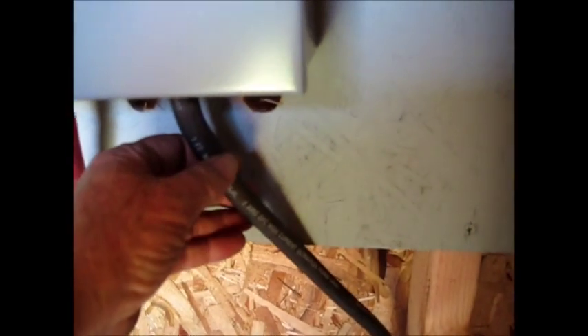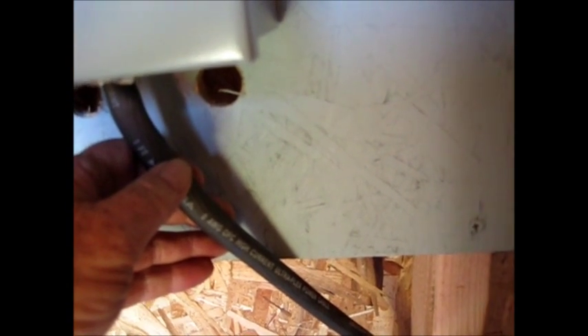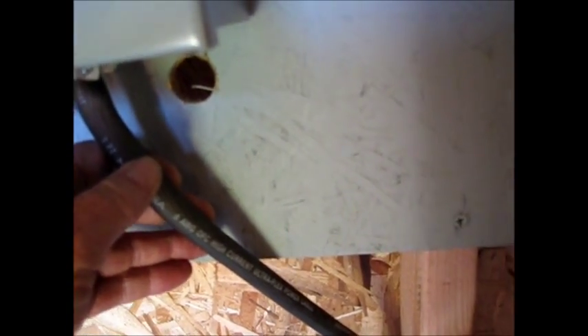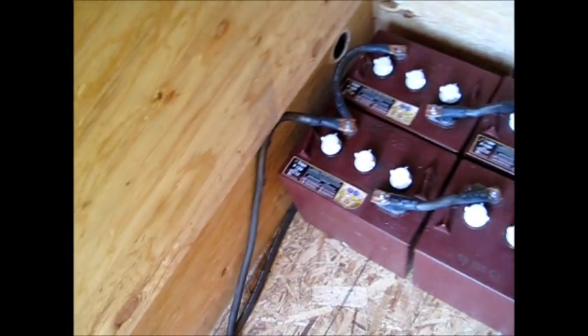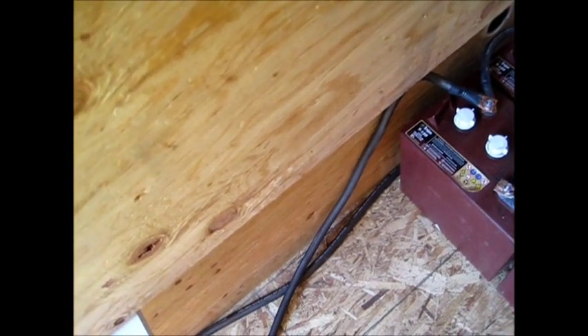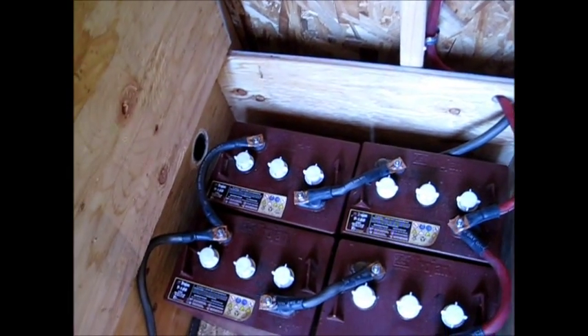I came off the batteries with some zero AWG OFC — oxygen-free copper — high-current cable, should be able to carry quite a bit of amps. Tied it off there, came in here to the battery. Used the same kind of connections to the batteries. I left the negative a little longer because once I fill up the battery box it'll end up back there, and I didn't want to keep buying new links. Put a little petroleum jelly on each of the connections and snugged them down.